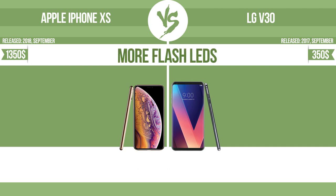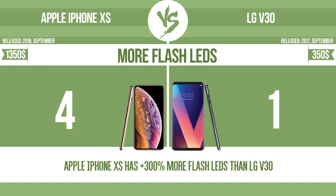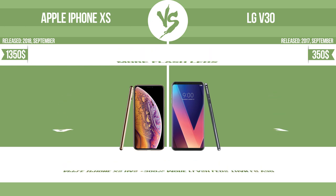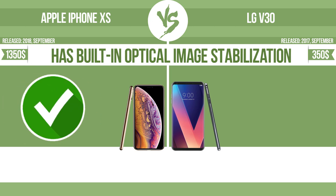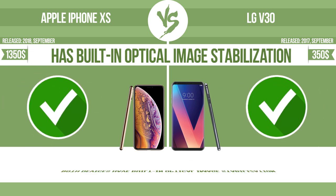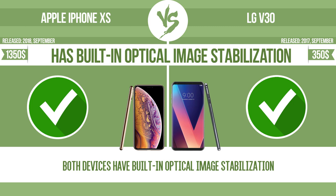More flash LEDs. Multi-LED camera flashes use LED lights which have different color temperatures — warm light and cool light — improving the color balance based on the conditions in which the photos are taken. Built-in optical image stabilization uses gyroscopic sensors to detect the vibrations of the camera. The lens adjusts the optical path accordingly, ensuring that any type of motion blur is corrected before the sensor captures the image.